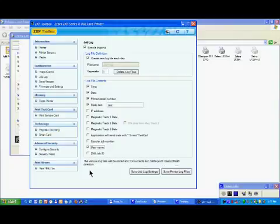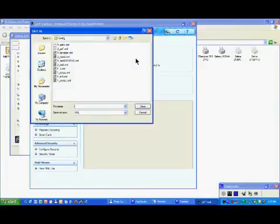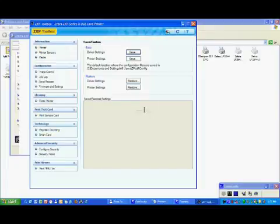Save and restore. You can save the driver and the printer settings, and they are going to be saved in this location. Very convenient to do, especially when you give a new printer to a customer. When everything is okay, just save both, give a name there, and then automatically you will have all the parameters from the driver and from the printer saved somewhere on the hard disk, here actually.